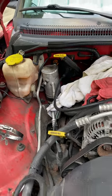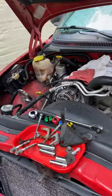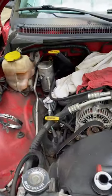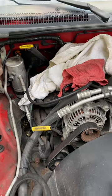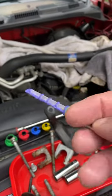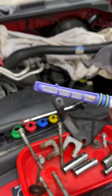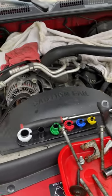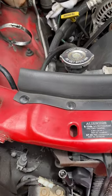I notice on YouTube I'm trying to find where the orifice tube goes, and it seems like nobody knows the answer to that. I found it when I was not looking for it obviously. This is a new orifice tube that has a little cross on the end, and that's the filtering system — it's brand new. I found it; it's actually in the condenser.